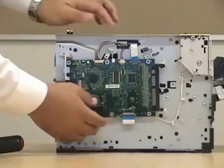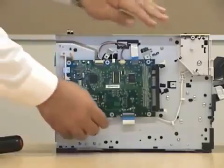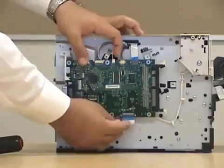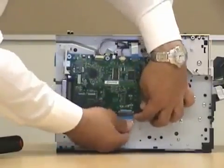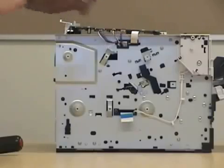Now the printer's card — where it holds the peripherals and the USB connection — you don't have to remove it completely. All you have to do is just remove this wire, and be very gentle in doing so. Then you can flip the card; it's out of the way.